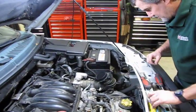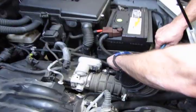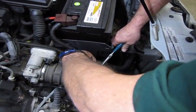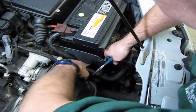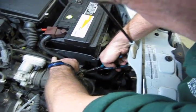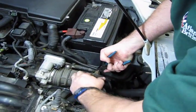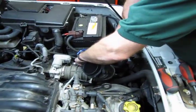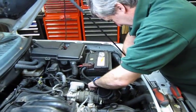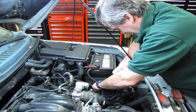And then we have a squeeze plug for this rear vacuum line, which connects in the back of the motor and ends up supplying the vacuum for the brake booster. Again, a white 90-degree elbow. This one has a squeeze type clamp on it, which if you work the end you can get it out without fooling around too much with the clamp.